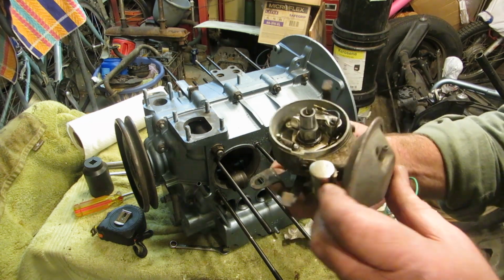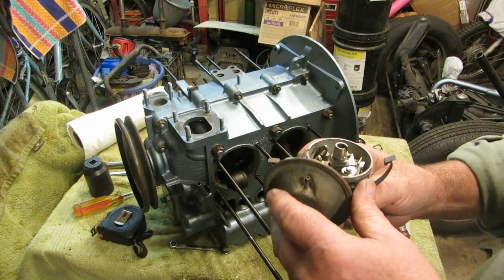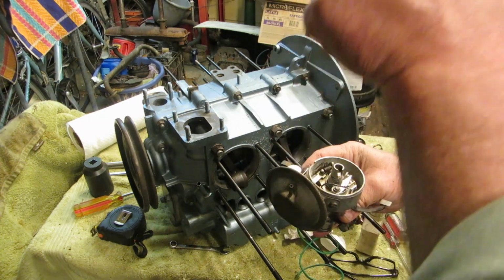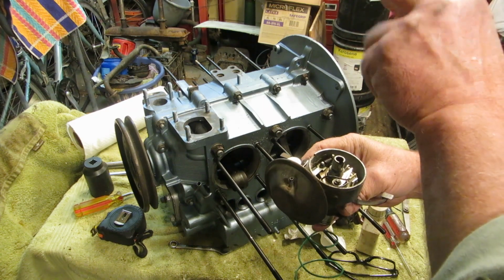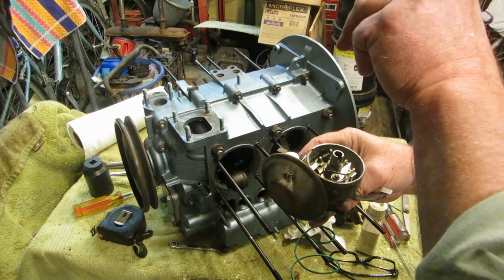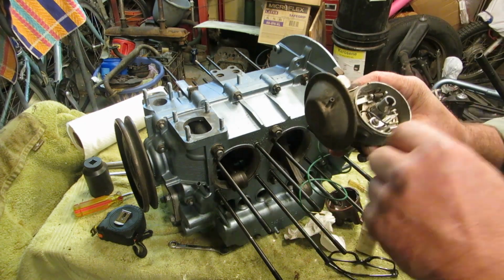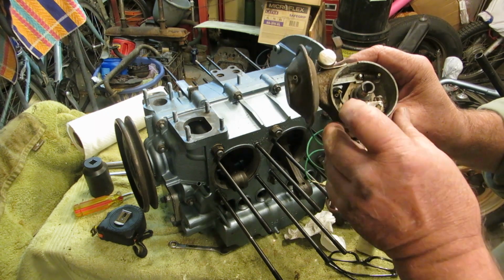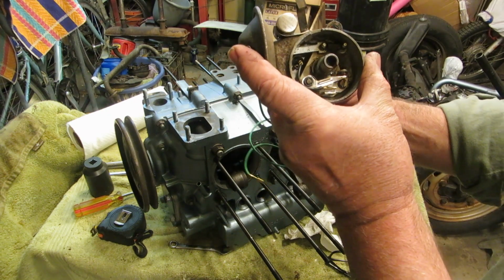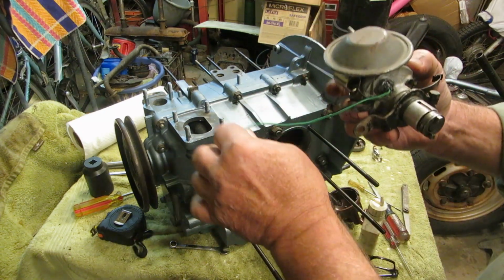We want to make sure our vacuum works, and it does. You want to make sure and have the correct piece that goes to the carburetor. It's got a little loop that goes to the top, and what it does is any gas fumes get in there, or any gas comes out of the carburetor from the vacuum, it keeps it low so it doesn't get sucked into the diaphragm and destroy the diaphragm. We've set our points at 18, 16 to 20. So they're 18 and they are clicking nicely. I have my wire plugged in there, so I think everything is hunky-dory there.